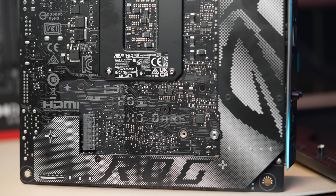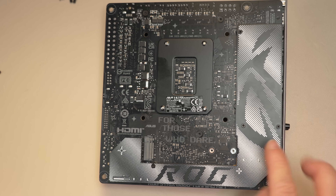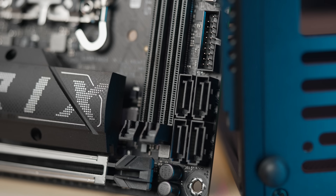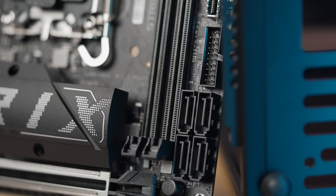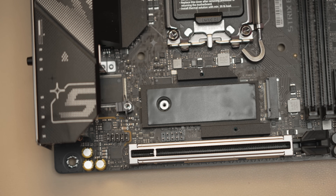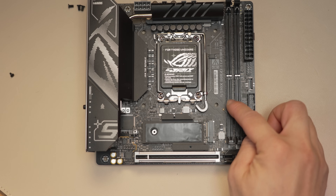One thing that's nicer about the B860 ITX versus the B850 ITX AMD board we just reviewed is that this board has a small metal back shield — purely for protection and cosmetic purposes, no thermal pads underneath — but stuff like this is typically reserved for higher-end boards, so it's nice to see on a mid-range board. Underneath the front M.2 slot is the x16 expansion slot — Gen 5 — equipped with ASUS's Q-Release Slim. When it's time to release your graphics card, you just tip the card toward the latch and it releases. I've been loving this feature on the X870 and B850 ITX boards; it's just so convenient.